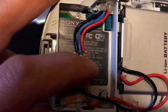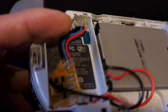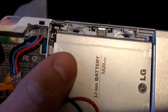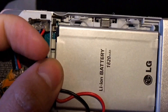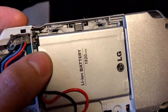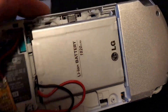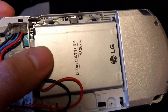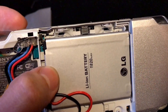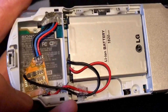You can then just solder it here, or if you're using the header, you just press it down and hot glue it in place. But basically, once this chip is attached, all you have to do is take any lithium-style rechargeable battery — anything that'll fit here. I'm planning on possibly getting something like a 2400 milliamp hour battery that's a little bit wider, that'll fit in this slot. Right now this is working pretty good. I've only been using it for about three or four hours, and I expect to get something like eight or nine hours of play time out of this battery.